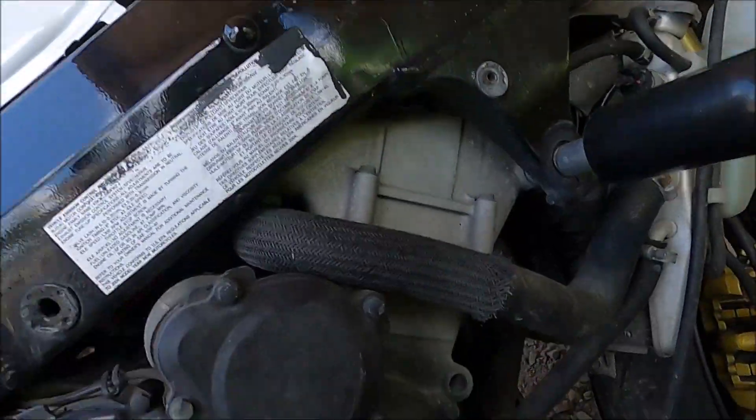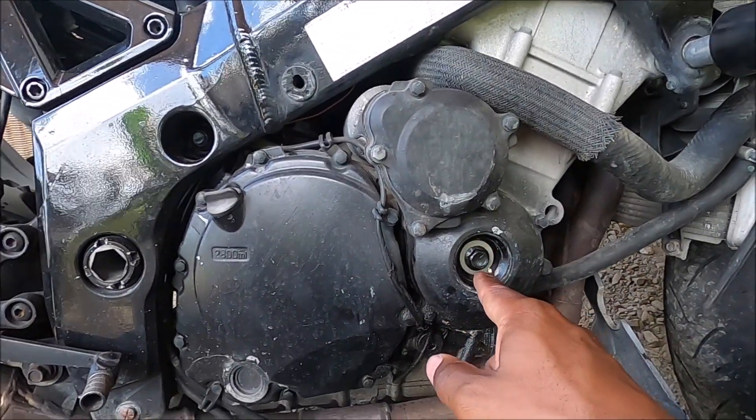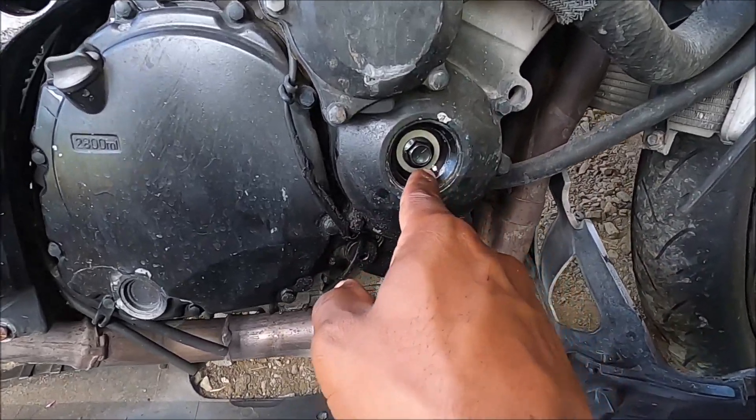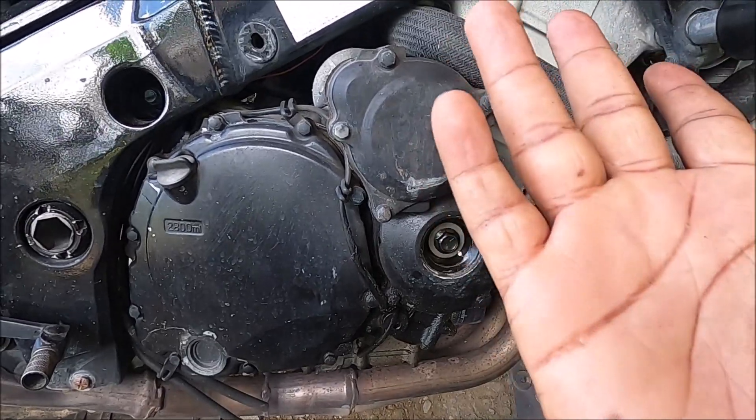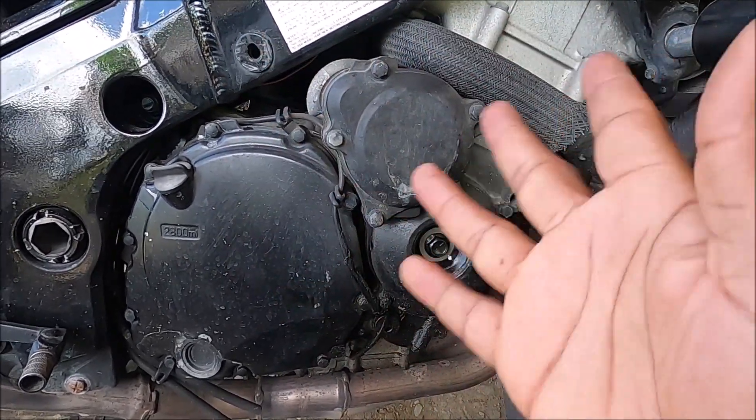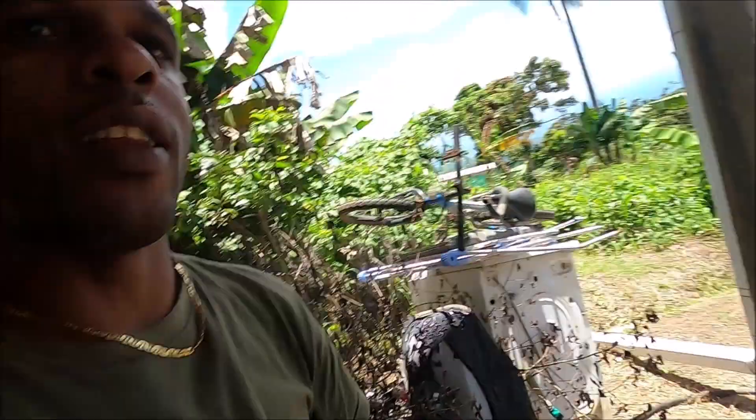I managed to pull out the trigger inspection timing tool for the bike. This white mark I made here — it has a little slot, and when it lines up to this little indentation that's top dead center. You're supposed to lock the timing to TDC and use a timing light to get it to line up, but my timing light decided to stop working, so I just began experimenting. The trigger angle can be anywhere from zero to 360 — I started at zero and it ended up being somewhere around 270 degrees. I'm not sure if it's completely synced, but it's in the ballpark and it starts.